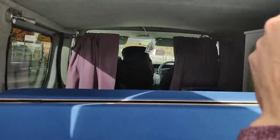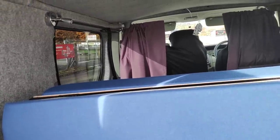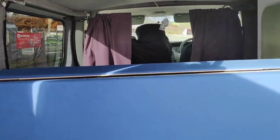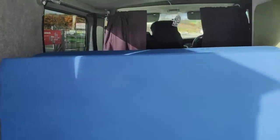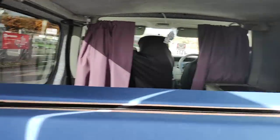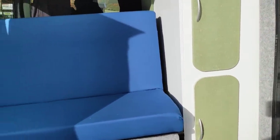All the panels behind here on both sides were stripped out and then there was a layer of double bubble insulation sheeting stuck to the walls and ceiling of the van. Then earth wool was used — which is basically like rock wool but eco-friendly insulation, not as itchy as loft insulation. It's made from old broken-down plastic bottles I think. That was all shoved in there, stuck in, and then the panels were carpeted while they were out of the van and then stuck back in again.